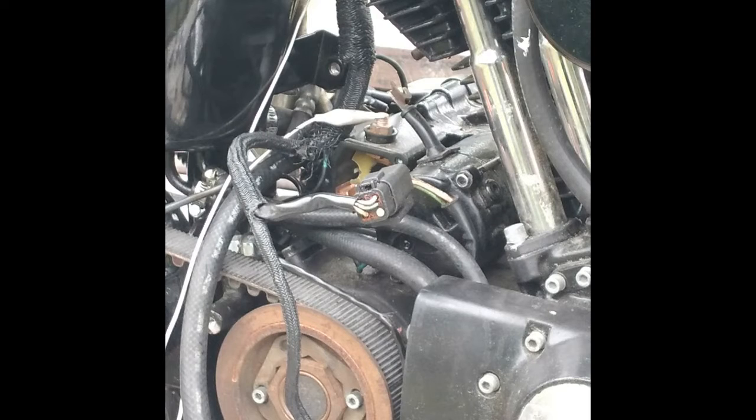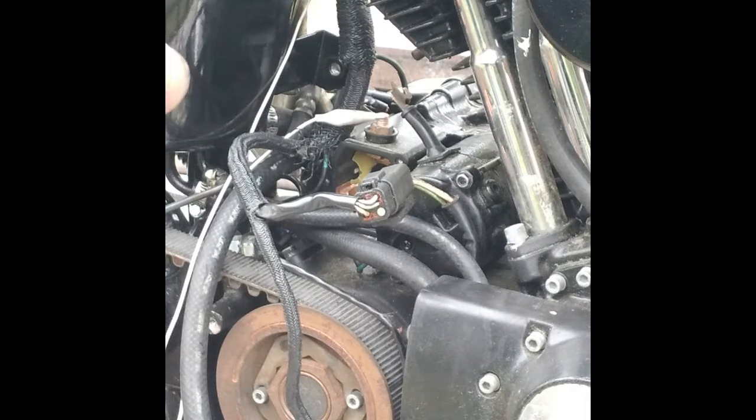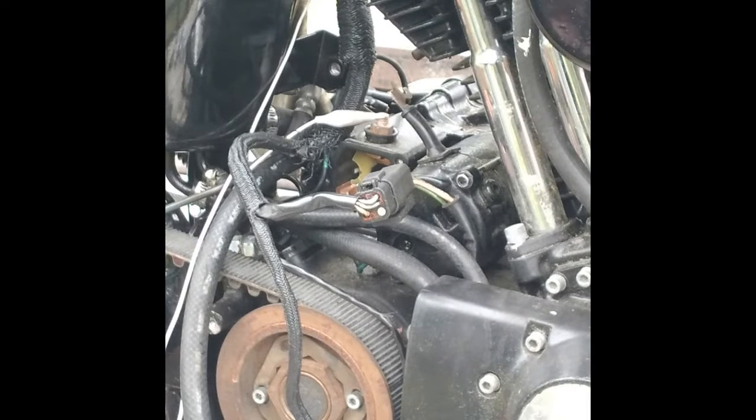At least we know where we're at. Pull-in coil's working, hold-in coil seems to be working — it just ain't making contact across the surfaces. So I'm going to take a little break. If the contacts are misaligned — if this one's a little bit lower than the other one, just a hair — what I can do is loosen this up and kind of push it in there, loosen the other one up and hold it in, then tighten them. Make sure I'm getting good contact across the faces.